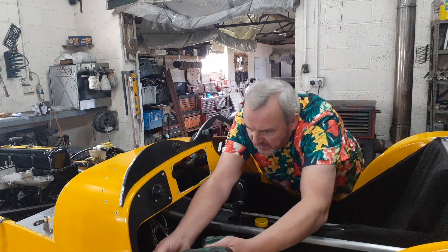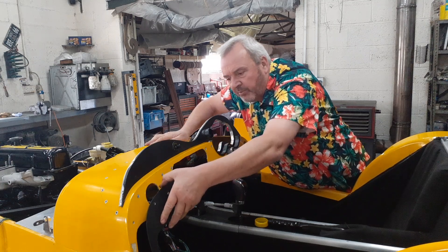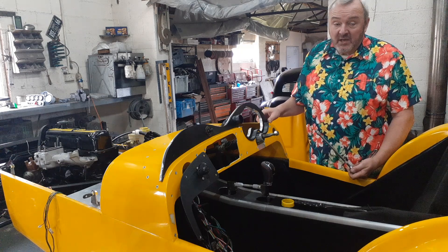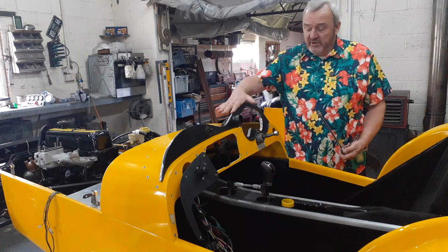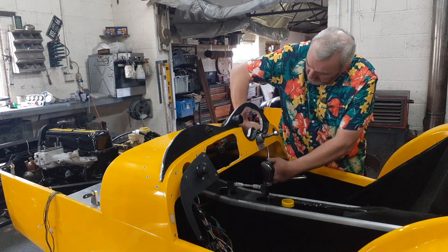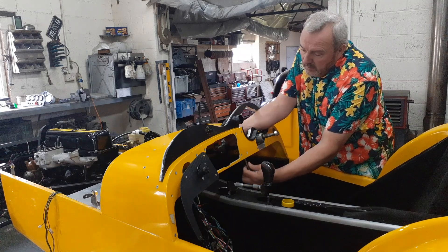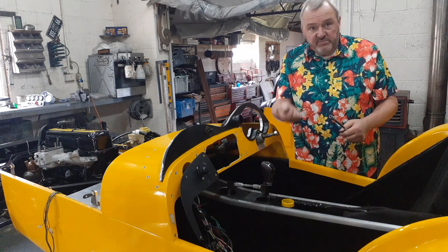Hopefully I can reach over just far enough to get this one out. It's not going to come right out because it's got the battery cables attached to the back of it now, but you can still see the principle — I can get it to there and reach anything that I need to. This is the main former for the top of the dash. It's actually a piece of 15mm thick aluminium which came out of a skip. I've drilled and tapped the top to hold the aero screen, drilled and tapped the bottom and put some studs in so it's nice and strong and rigid. You can also see there's a nice big spreader washer on the back so it doesn't put too much point loading on the fibreglass. And that's how it lifts off.